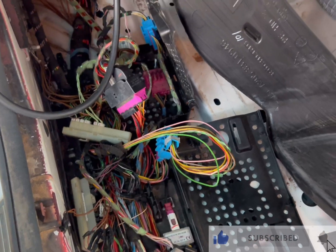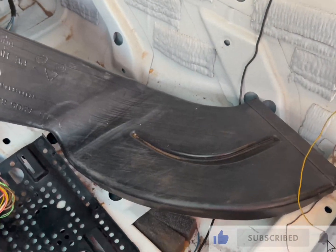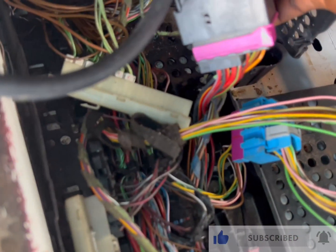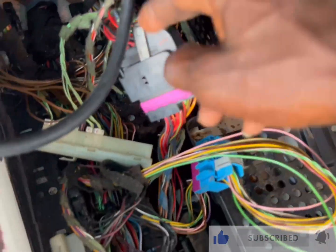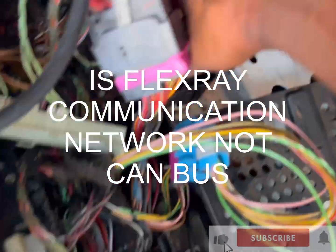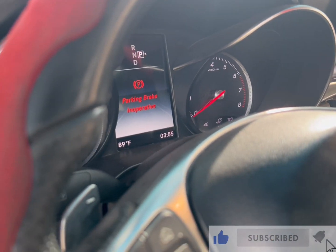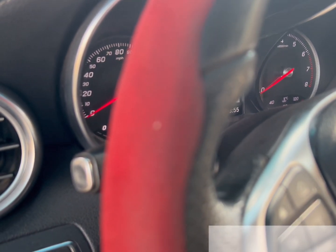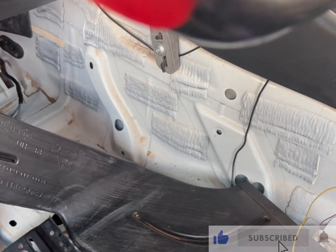It's not a very expensive job, but it took much time to verify the problem. Afterwards, there was also a problem with the power steering. As you can see over here, this is the flex ray communication CAN cable. I was having a faulty communication with this, so the power steering warning was on. As I said earlier, the keyless-go is somehow suspected faulty — but I don't think so. It's not faulty because the machine can communicate with it, and as long as it communicates it means it's working. There's no fault in it.